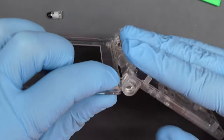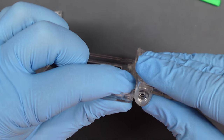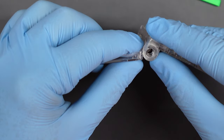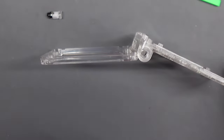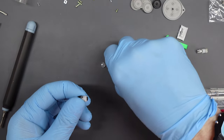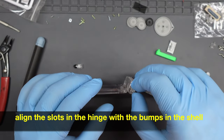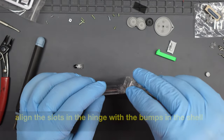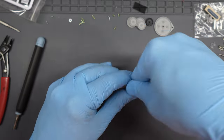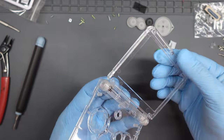Get the screen frame and control panel from the new shell. Put them on their side, look into the hole, and rotate the two pieces until the little bumps inside are aligned — the same angle as when the screen hinges are open. Slide the old hinge caps off and put the new caps on from the shell kit. Align the hinge, push down with firm thumb pressure and it clicks in place. Flip it over, do the same on the other side, then test that it opens and closes properly.